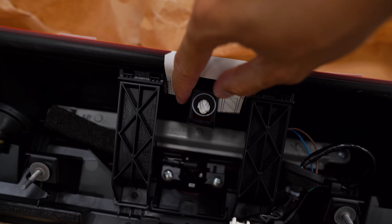All we have to do now is get this back on the car. Feed the wiring harnesses through the holes, align the studs, and pop everything into place. Get those harnesses plugged back in, make sure you pull the grommets through to make a good seal. Reinstall the six nuts — make sure not to drop them — then reinstall the cover. Don't forget to reinstall the four eight-millimeter bolts on both sides, and that's going to do it.